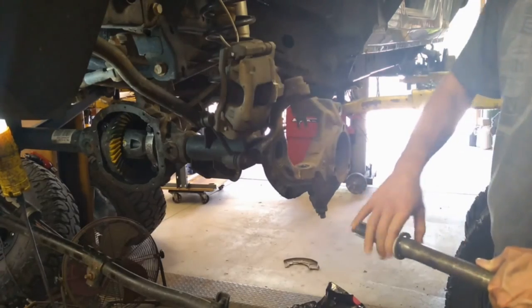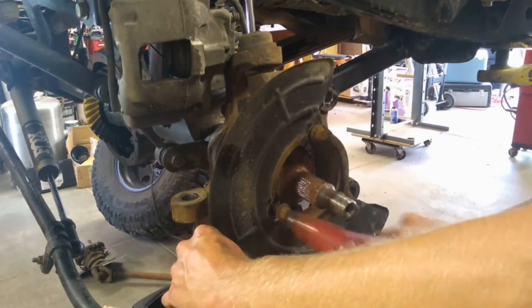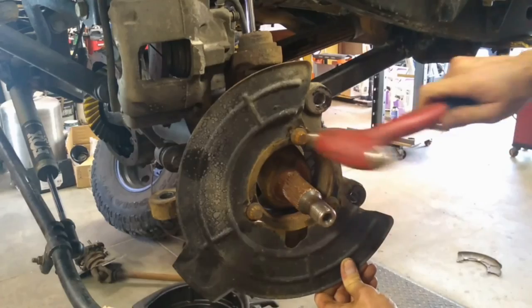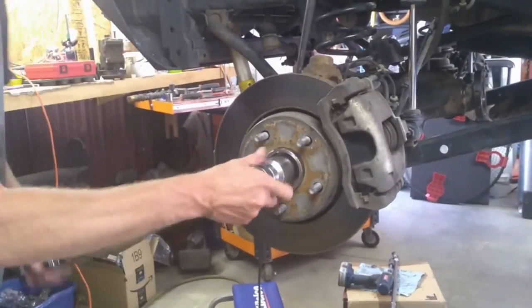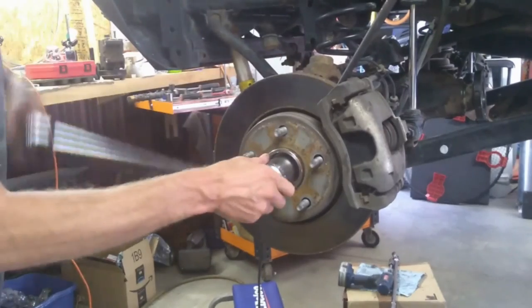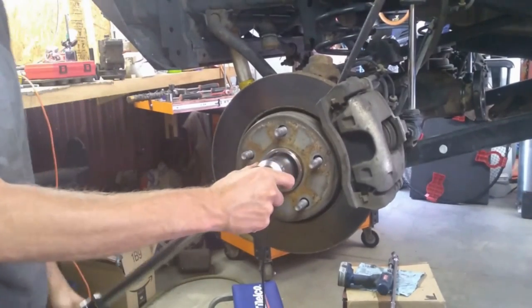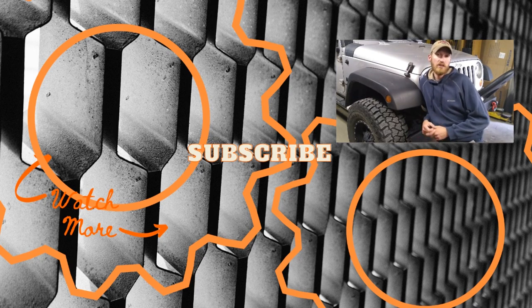Finishing up assembly: I clean the axle tubes all out, clean the axle shafts, and lube the axle shafts before I put them in. Here's my trick for the backing plates — a little bit with a punch and then put your bolts in from the back side, and that gets everything all set up. To torque the axle nut, my favorite trick is to throw a pry bar in the vents on the rotor — that allows it to grab the caliper so we can torque down the axle nuts to the proper torque. Make sure you look it up — super important for the right axle bearing preload. Thanks for taking the time to watch the video. If you found it educational or even remotely entertaining, please like and subscribe. I know this video is missing some things — you'll find them in the Dana 44 rebuild, so check it out.